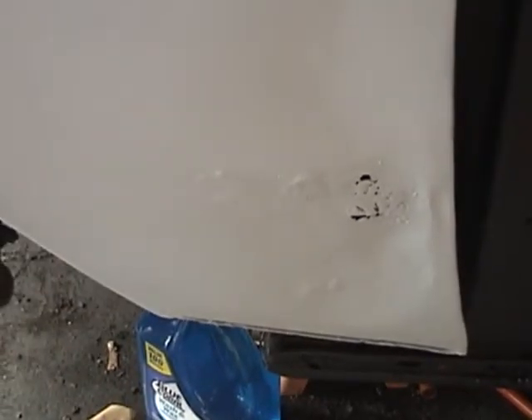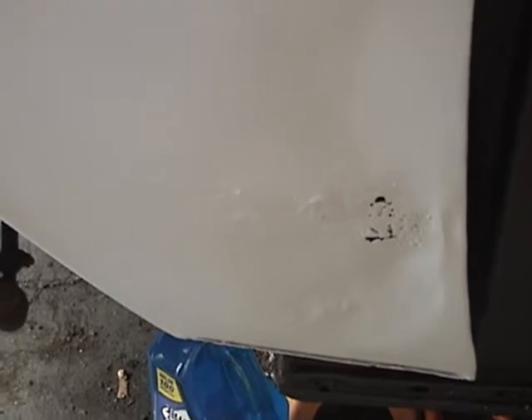What you see here is actually damage I caused by trying to weld up one single drill hole right over here. I was having trouble welding that one hole, and I just kept going over it, grinding and trying to weld over it, and eventually I just made a huge mess of it. I figured it was probably best to just cut my losses and repair this with fiberglass and finish the fender out with Bondo. All in all, seeing how I was able to weld up maybe four or five other holes, I'm really pleased with it — I've actually never had this much success with welding before, believe it or not.